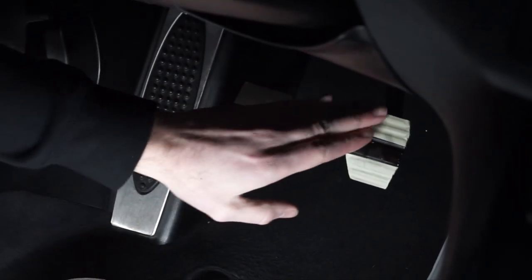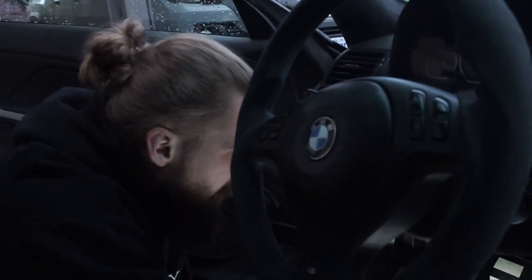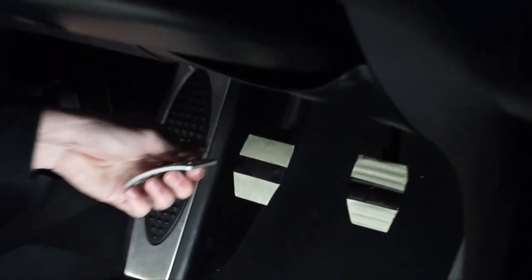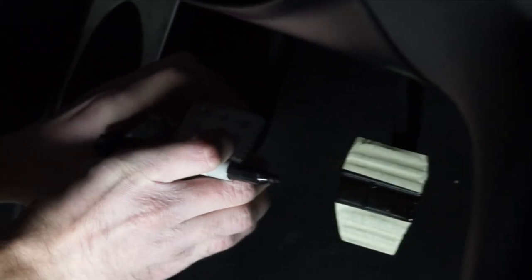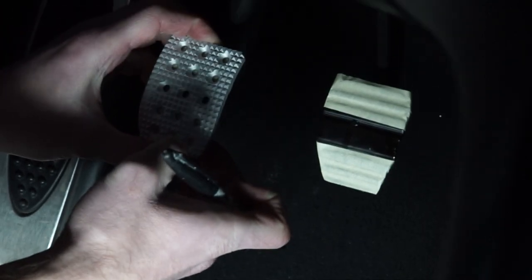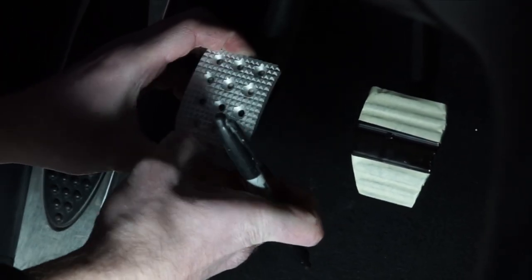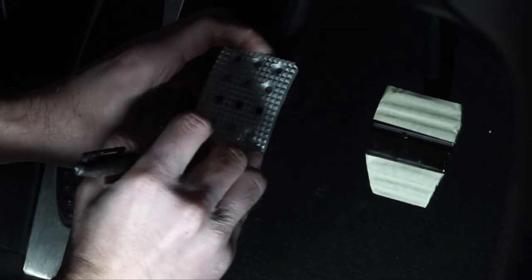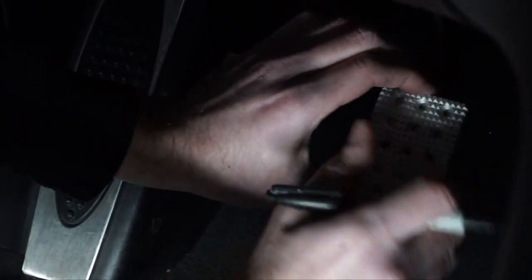To make the most accurate marks, you want to kind of mask off where you think you're going to be drilling. Mask it off, take a sharpie, take your pedal that you have, and align it with the top and sides as evenly as you can. Keep in mind that you're going to have to be drilling holes in behind, and find a place behind the pedal that doesn't have a lot of material, so you can mark your areas accordingly. You do the same on both because the clutch pedal and the brake pedal are actually exactly the same.